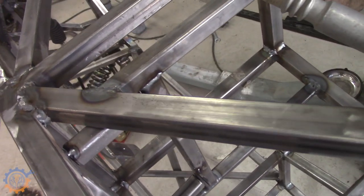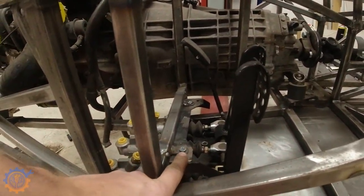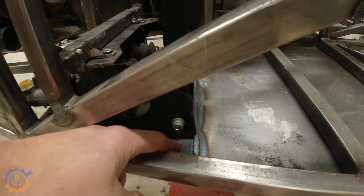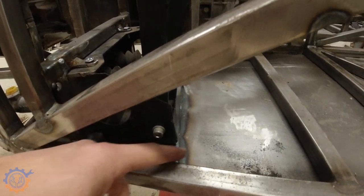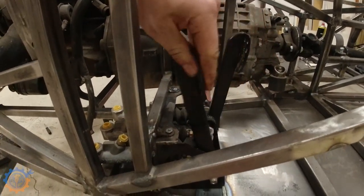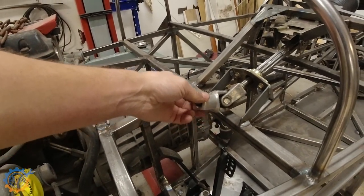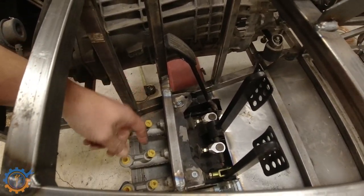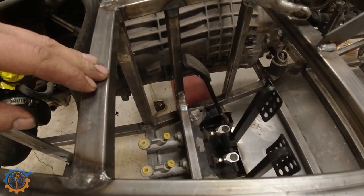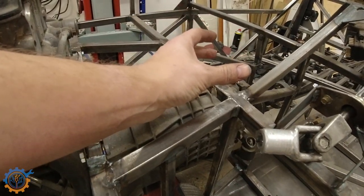I will show you how it looks when disassembled. Here we have the pedals in place — you can see the M6 bolts at the top and the plate underneath. This is also supported by the flooring sheeting, and it's solidly welded here; this will never go anywhere. It will be covered by the sheet going up here, protecting the actual steering as well. We also need to do some piping for the brake fluids. The brake fluid reservoir itself will be sitting either on the inside here or up here somewhere — we'll see about that.